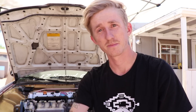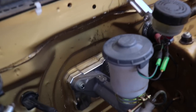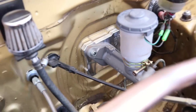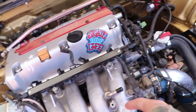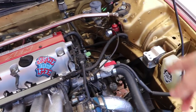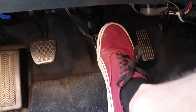Let me just show you really quick what it looks like. Don't mind the brake fluid everywhere — I ran into some issues when I was doing brakes when I first did the swap. As you can see, there's brake fluid all over the firewall and all over the strut tower. But this plate right here with the H on it — that would be your brake booster delete plate. Obviously there are no vacuum lines running to it. Here on my intake manifold, this vacuum cap is the port that would normally be running across the engine bay to my booster. If you're going for a clean look, that vacuum line would be an issue because you can't really tuck it. But it looks good and functions good.